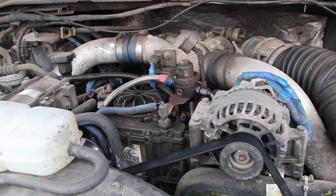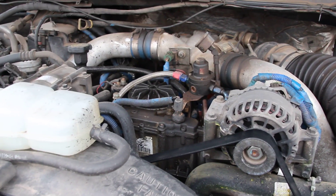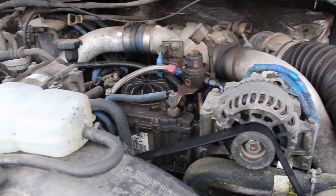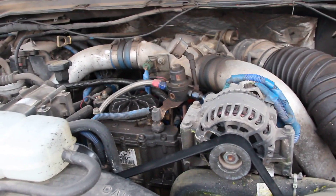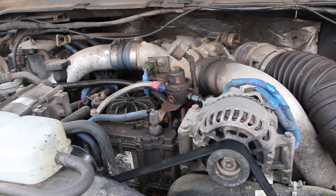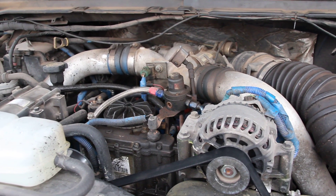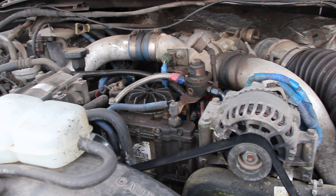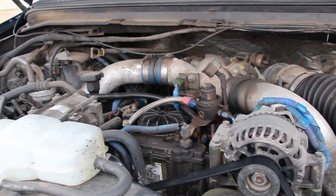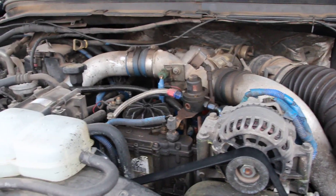That fuel pressure regulator is a Mallory and it's not actually diesel rated. It's been two, three years and I haven't really had any problems with it — it leaks, but I haven't really had any serious problems. I think the only one that was diesel rated when I went looking was an Aeroquip, and they want quite a bit of money for that one. So take it as you will — it's your choice as to how you want to do it, but I've had pretty good luck with it. I like the modification. This was a request of somebody that subscribed to my channel — they wanted to see what my modifications were to my fuel system. Hopefully that gives you a basic idea. It's been 15,000 miles in about two years that it's been in the vehicle; I've just kind of forgot about it. If you have any questions, let me know. Thanks.